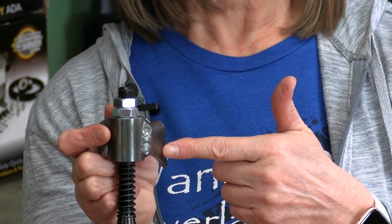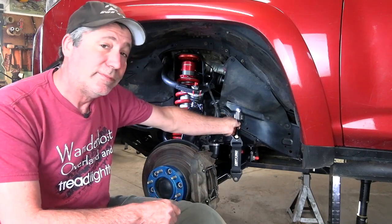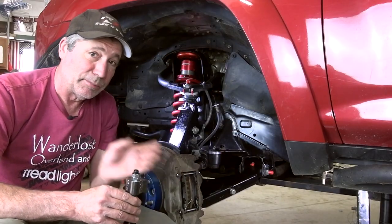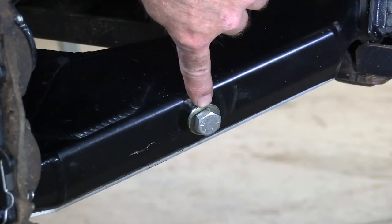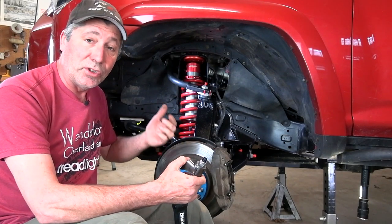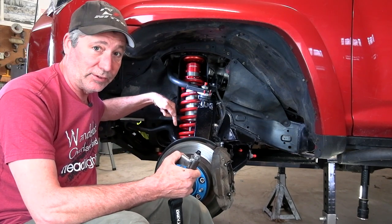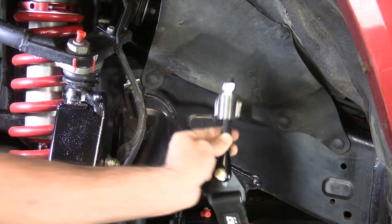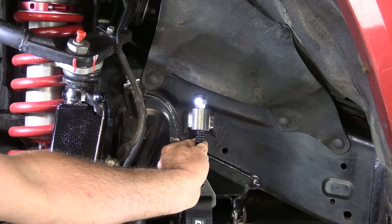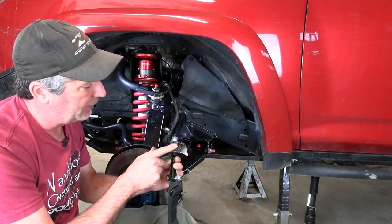This part has to be welded onto the frame. Here's where we'll be putting them. Lucky for us, on our lower arms, Dirt King puts a convenient place to mount the bottom right here. Otherwise, they could be mounted at the lower shock mount using a longer bolt and a spacer. At the top, we need to have this small bracket welded onto the frame right there.